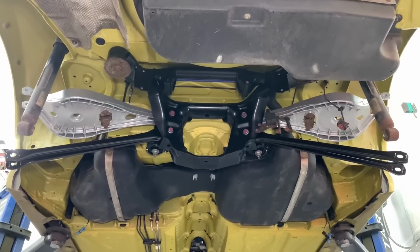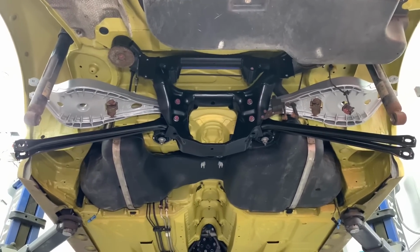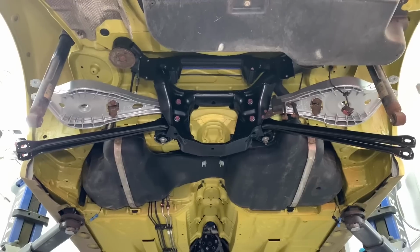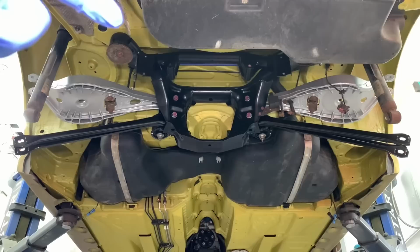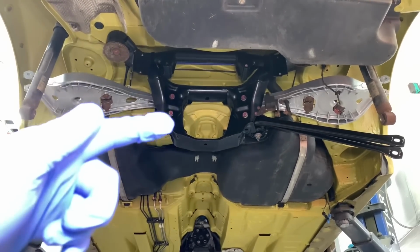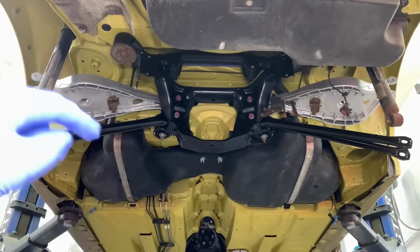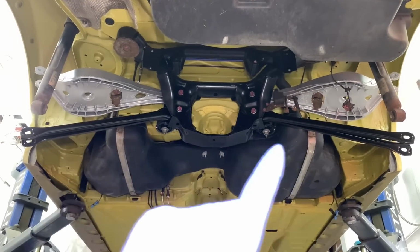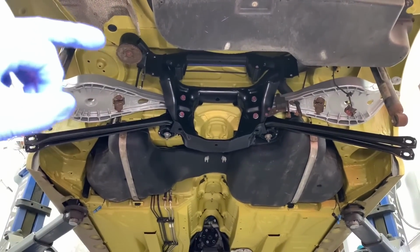Now, this owner originally hadn't planned for any powder coating work. It's just evolved as the process has gone on, and you can see benefits and time-saving natures of crossover jobs, like whilst all the axle's out for this work, it makes sense to change all the subframe bushes. And well, if all the subframe bushes are coming out, well, it makes sense to powder coat the cradle, for example. So there's powder coated diff carrier in black, powder coated spring arms in aluminium silver, new lower arms as well, obviously bushes for those top and bottom arms, and the subframe bushes.